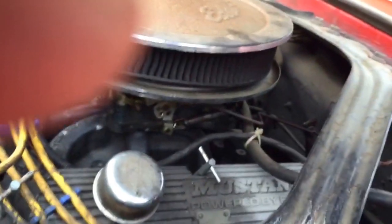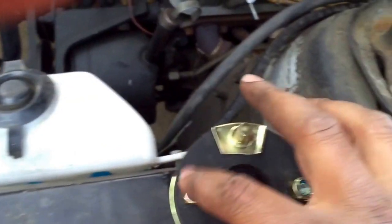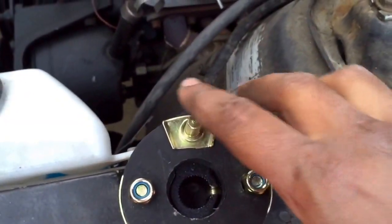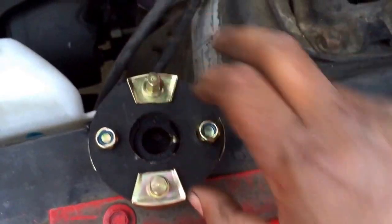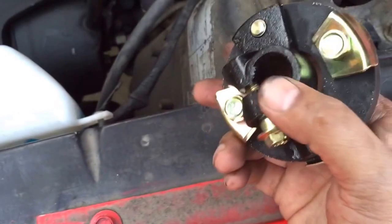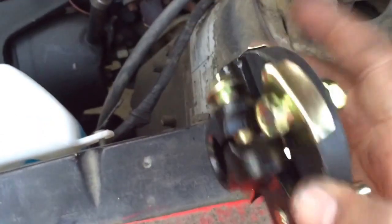The way this coupling works: the steering column bolts onto these two points. It's like an emergency mechanism — if you go over a bump and the rubber breaks, there's a fork that grabs onto those two things. This part then goes onto the steering box.